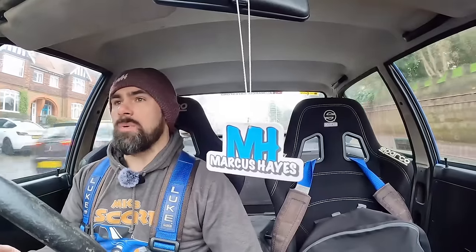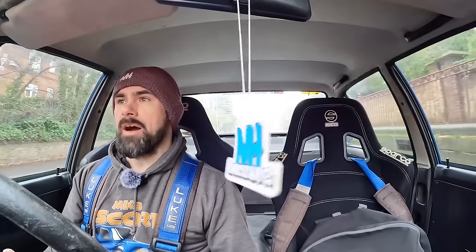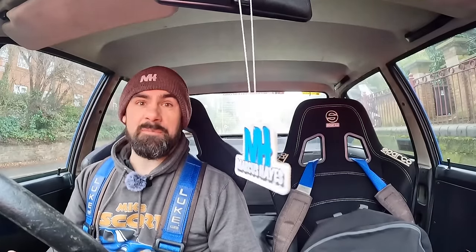There's definitely loads of noise coming from the rear end of this thing. If you've been watching my videos, you'll know that I recently nicked the diff and the half shafts from my other Mk2 Escort that I call Heidi. That car has been off the road for years — I bought it as a rolling project. So these half shafts and this diff, I don't know the history of. The bearings on these half shafts were very rusty looking, so I don't know if the noise is coming from them. The noise isn't a hum — normally with wheel bearings you get a humming sound. This is more of a different sort of thing. Yeah, maybe it's the diff bearings.